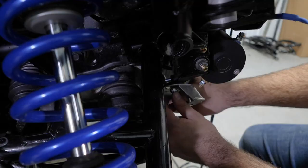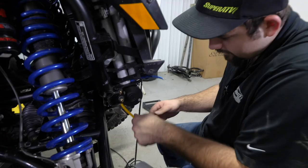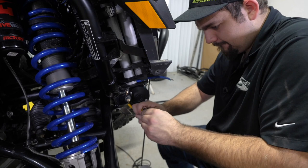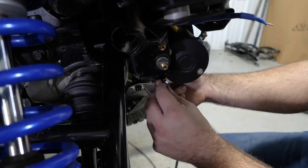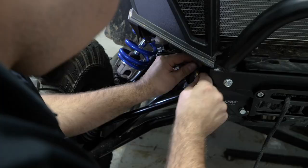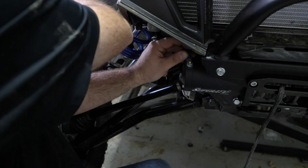All right, we loosened it up. And we're going to go ahead and loosen the nut off of the terminal for the yellow wire. We're going to go ahead and grab it. I'm going to pull it out here a little bit and I'm going to put my cover on. Slide it on there. Make sure you have your washers on. And run that wire all the way up. And we'll go up here to our blue post. Connect the blue wire.